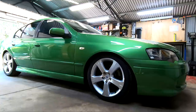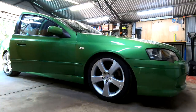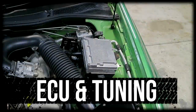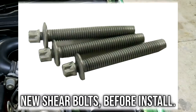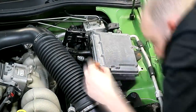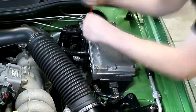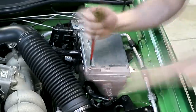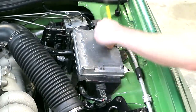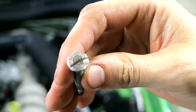I find the best way to start work on something like this is to go for a little drive, so everything is super hot and you have to wait for it to cool — and I wonder why things take me so long. Not an issue for me this time though; I'm starting by jacking up the car then removing the ECU. The heads of the bolts for these are designed to snap off during install at the factory at a specific torque rating to make them tamper proof, but thankfully not idiot proof, so I can still get these out. A slot is carefully cut in the middle of the head for a flat screwdriver bit.